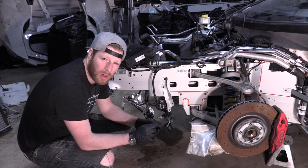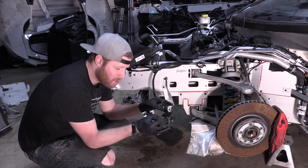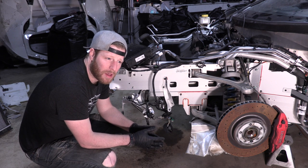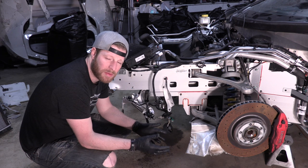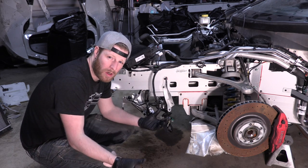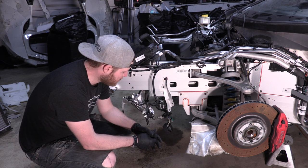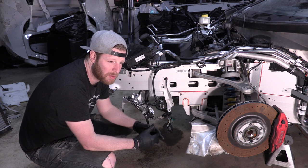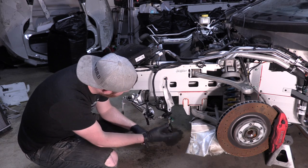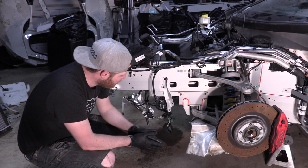In this episode we're going to plastic weld the holes — there are multiple holes. Both the studs where the radiator mounted, which were made out of plastic, broke off, leaving two holes. We're going to plastic weld those to have a temporary radiator setup so we can kick the engine on. For the long term, if I can't find a cheap replacement radiator, we're going to get some aluminum and replace that whole bottom plastic pan with aluminum — remove all the plastic, rebuild it in aluminum, and weld it on watertight. Factory ones are about $850, so I'm not paying that for a radiator.